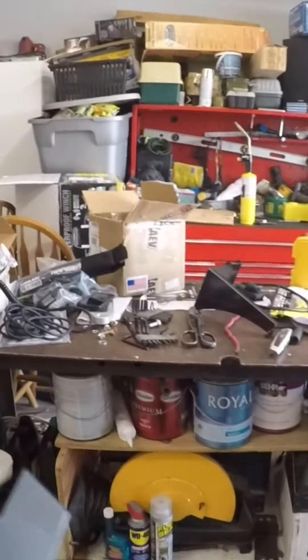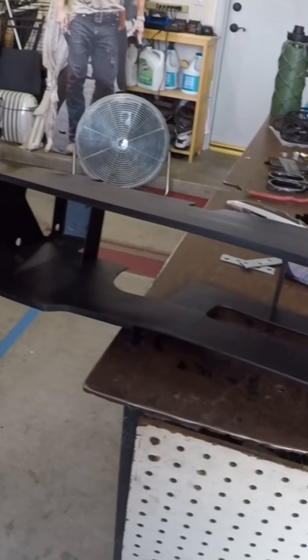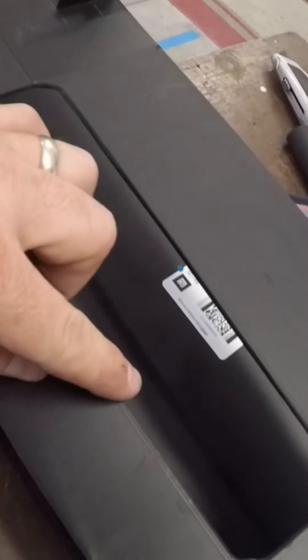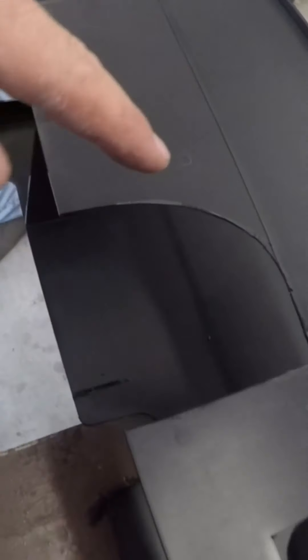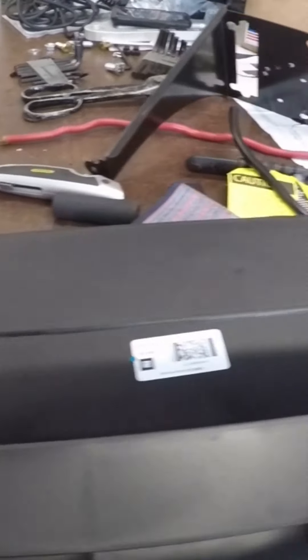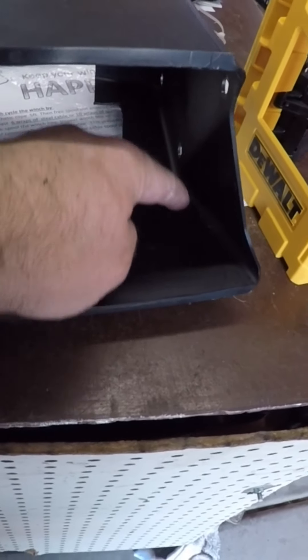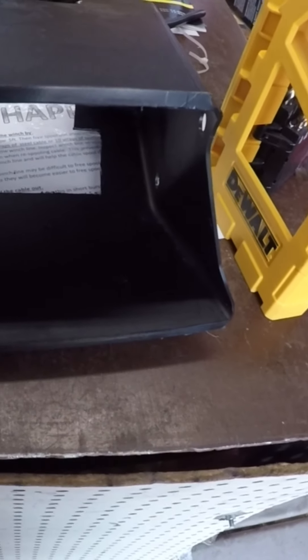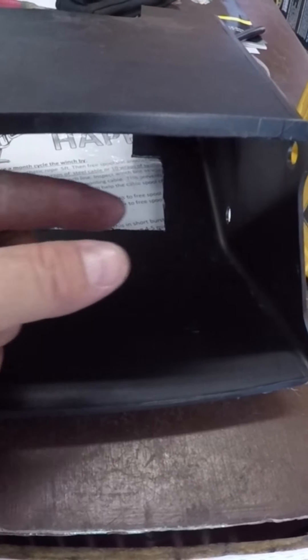This is the plastic piece that goes in that front bumper. There is a cutout here for you to cut out for the winch — you can see the winch. I cut this out for the handle to engage and disengage the clutch. And on this side, we cut this out for the electrical box. The electrical box is going to sit right here. We ran two bolts and nuts through from underneath. The on/off switch will be right here, and you'll see the X20 emblem, which is kind of cool.